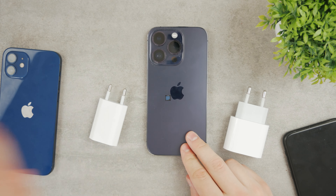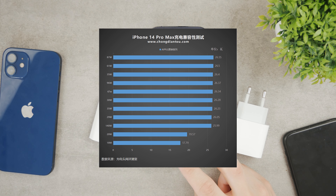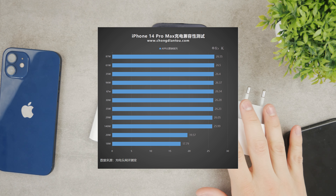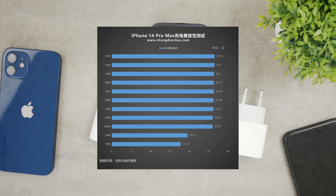This has been tested. As you can see on the screen, this is the data showing what's really going on with the iPhone battery and charging. The data is in Chinese, but it tracks how much wattage can actually get to the iPhone. If you use an 18W power brick, 17.79W — so almost the entire thing just gets through, using the full potential of the power brick.